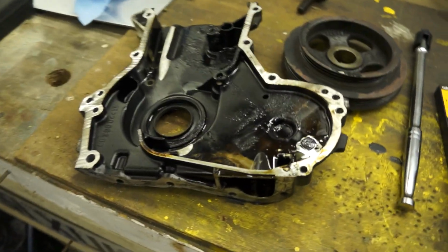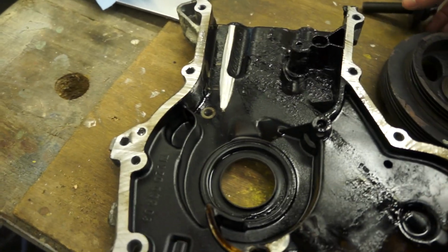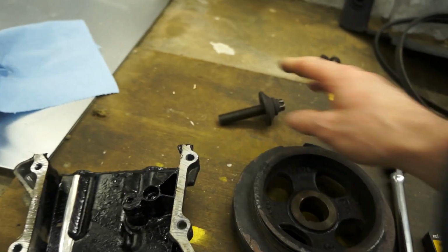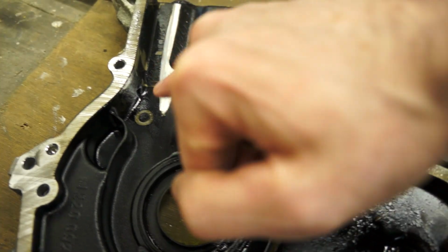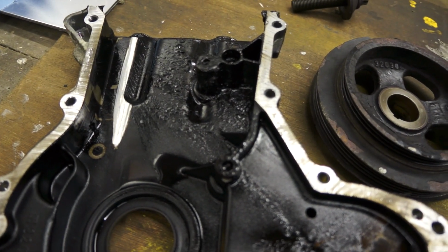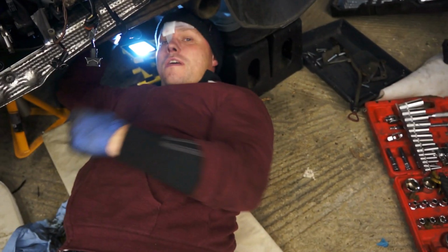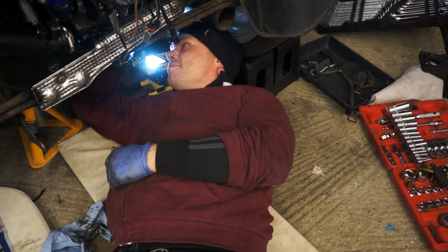What I'll do is show you on the bench. So obviously the bottom pulley, here's the nasty bolt to get off. But what's interesting, you can sort of see the state of it, but you can see the scoring all the way along here from where that chain has been loose, and the guides have pretty much just failed. So if I go to Darren, who you probably notice is sporting injuries, a bit of headwear. Go on, Darren.